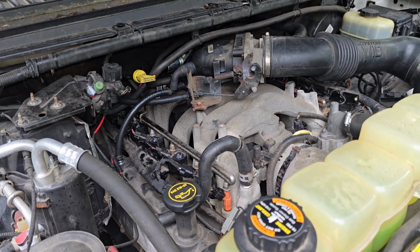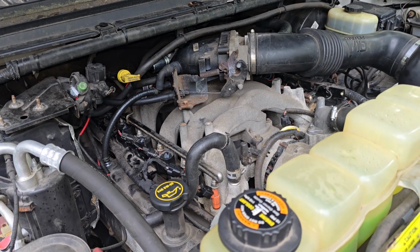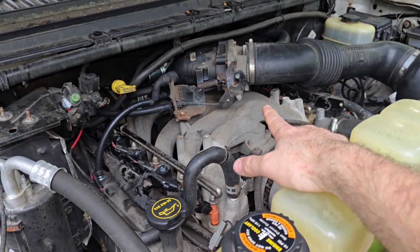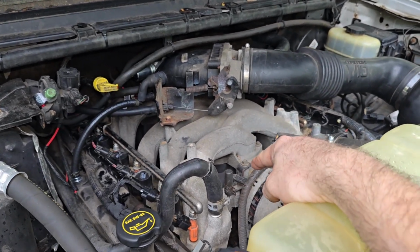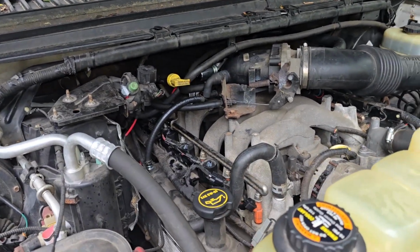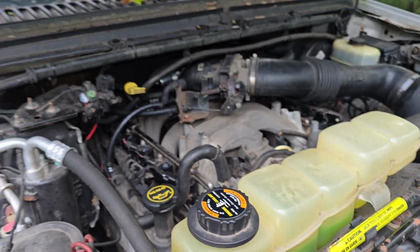Now I've got my fuel injection test machine. So what I'm going to do, we're going to disassemble everything, take the fuel rail out. I could just do the fuel rail. Maybe I start with that, run the injectors through the cleaning. If I find another smoking gun, save my time, put it back together. If that doesn't solve anything, then my next step would be to remove the upper and lower intake manifolds and check them. The lower one is plastic. Doesn't seem like they're too prone to crack, but it's always possible. I could check it for cracks, I could just fill the darn thing up with water or something like that. Obviously it's not cracked enough to fail a smoke test, but see if maybe that's something.